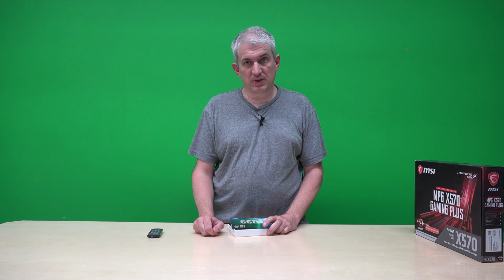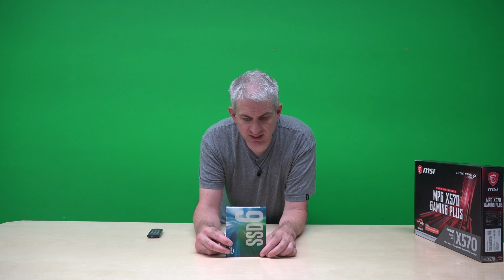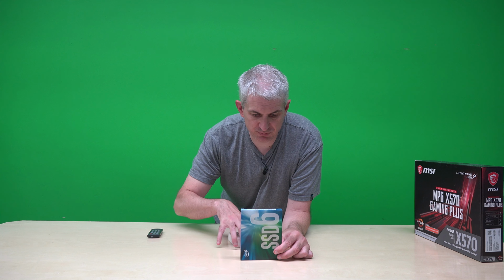And what currently that really means is these SSDs that are available to us get pretty different performance numbers and benchmarks. So this is the one we usually use. It's an Intel SSD. It's rated for and gets about 1,800 megabytes per second. And by the way, the PCI Express 3.0 bus, which is in all the Intel stuff, I think is limited to about 3,000, if I'm not mistaken, megabytes per second. So this isn't actually maxing out that bus as it is.